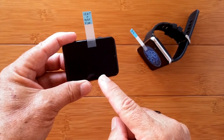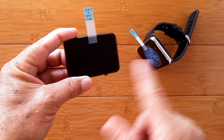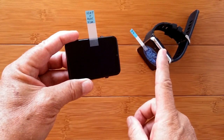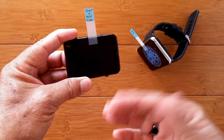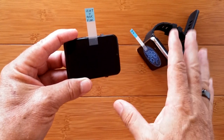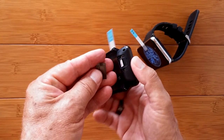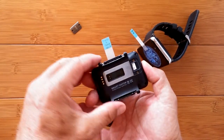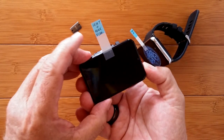First, you have to have a data SIM that you can put in the watch that is compatible with the networks these watches run on. That's the GSM network, which means you need AT&T or T-Mobile, or a derivative of those networks in the United States. Take the SIM cover off the back of the watch, put the SIM in, and then turn it on.